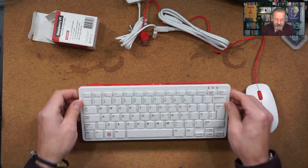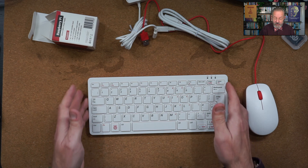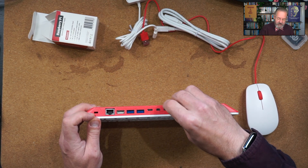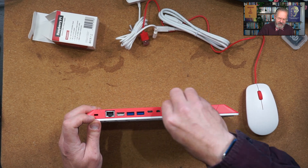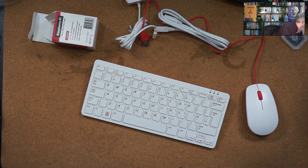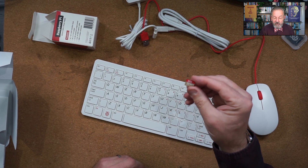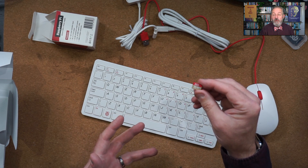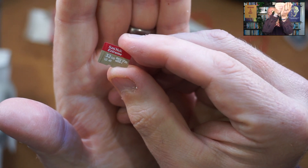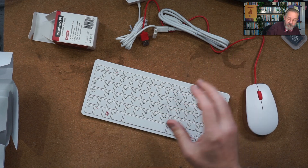In terms of the specs, as I've said, it's a slightly boosted Pi 4 — 1.8GHz rather than 1.5GHz, with 4 gigabytes of RAM. The microSD card that comes with it in the kit is 16GB, which is enough to get you started. It's an A1 card. You can get A2 cards as well — they'll be slightly more expensive, but they're slightly better optimised for application performance. A1 refers to how fast the card works for random I/O used by applications.